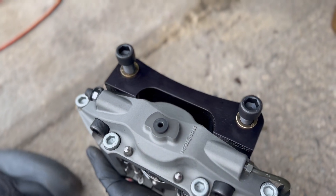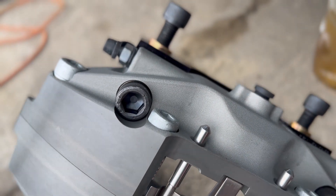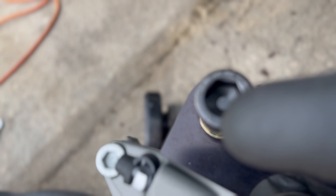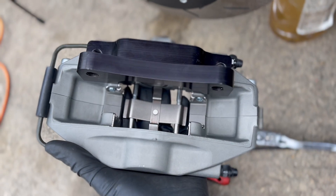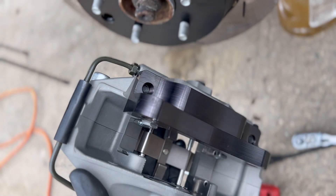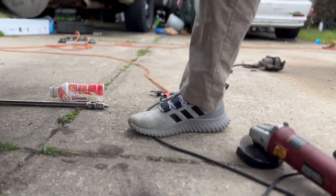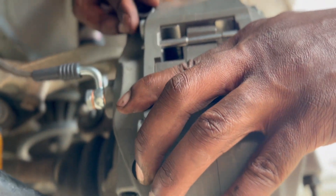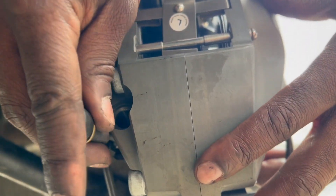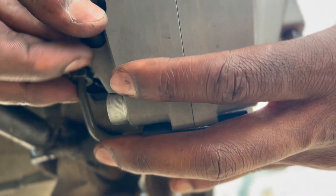The bracket side for the rotor is simple enough. It's got a little note that says 'rotor side' that goes towards the caliper. Thread the screws into the top then to the side — these screws are what's going to mount to the actual bracket on the hub. The bracket actually goes on the inside like that and then still threads in to the top and bolts on back there.